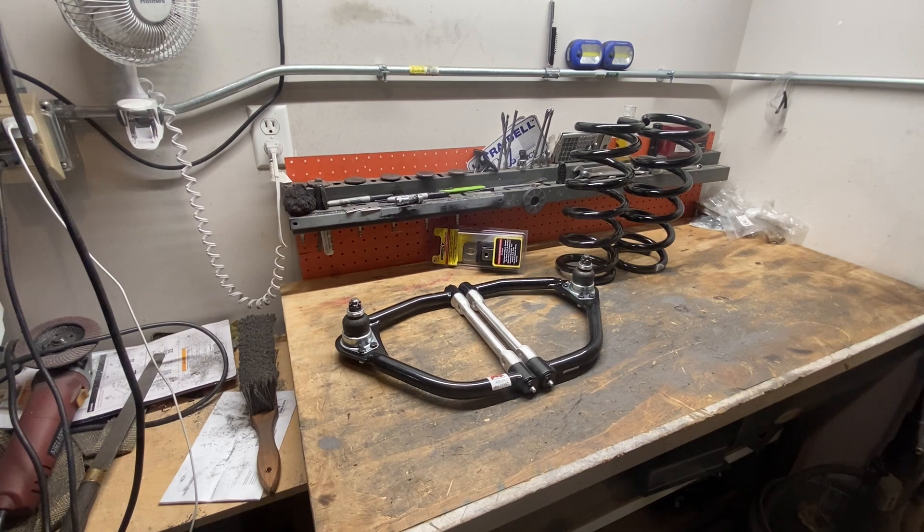This is a learning process — I'm in a whole new world with this vehicle making a lot more power than I've ever made before and it is not happy. The plan is to get the driveline angles figured out, get my rear pinion angle set, then start looking at aftermarket valving shocks and possibly going to split mono leaf springs.